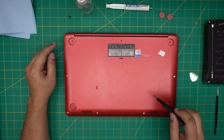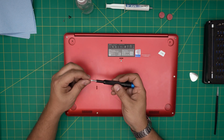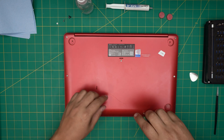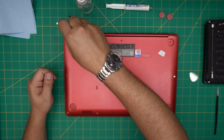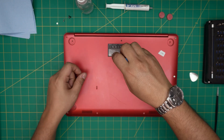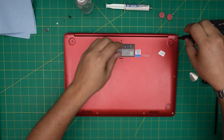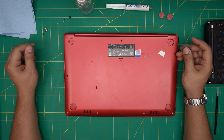The rest on the side and back are medium screws. Note: one screw here is broken because the client dropped the laptop — it just rotates and won't come out, so we'll leave that one. Remove all the remaining screws and keep them sorted in different piles by size. Once all screws are removed, we're ready to open the case.